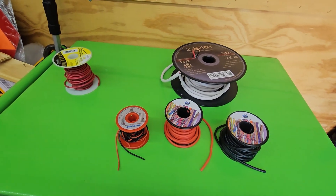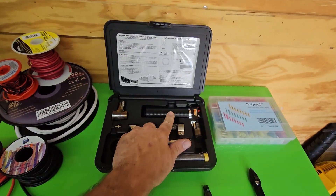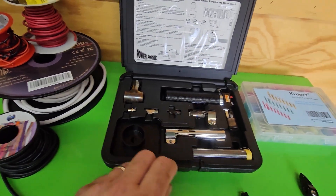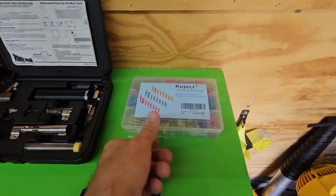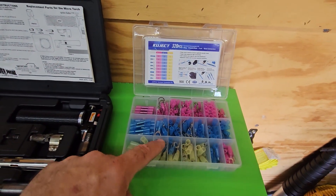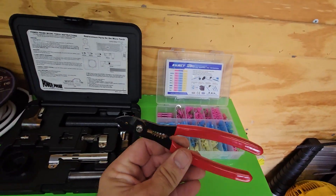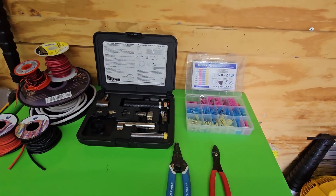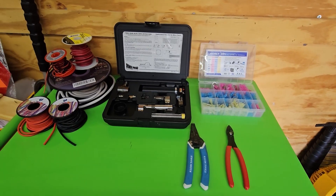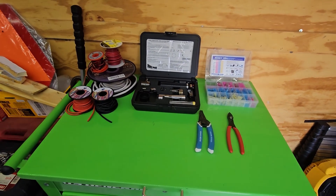When it comes to tools, it's not too many. You're going to need a microtorch or a little heat gun for heat shrinking or soldering. We're using marine heat shrink terminals — you can pinch them on or solder them on and the heat shrink tube on the end helps seal it. You'll also need wire strippers/cutters and a crimping tool to crimp the crimp connections. The wire and these tools will get everything wired in. I'll leave links to them down below — they're probably affiliate links through Amazon and help the channel if you click them.